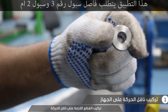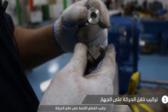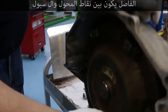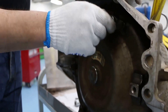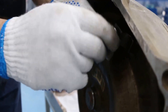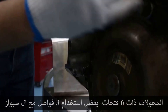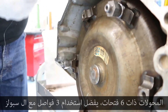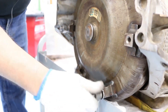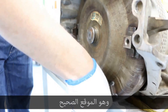This application calls for spool spacer number 3s and spools 2Ms. The spacer goes between the torque converter points and the spool. On converters with six holes, it's preferable to do three spacers and spools. This will give you at least three points of contact to keep the torque converter forward and in its correct position.